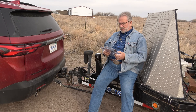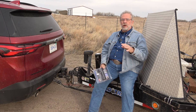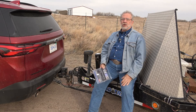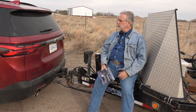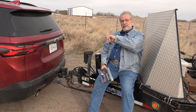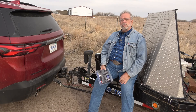One of the laws on trailering — in Colorado I think it's three thousand pounds, you have to have brakes on the trailer, and in California it's like thirteen or sixteen hundred pounds, it's really light. So look up your state and see what it is. We're going to take it down the road and show you what it does. We've got a five thousand pound trailer, which is the maximum tow capacity for this crossover, so we'll try all that out and see how the brakes work.